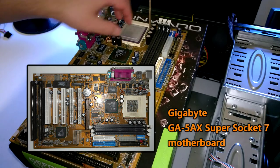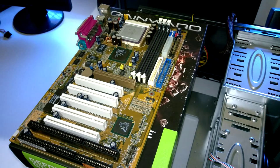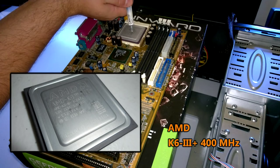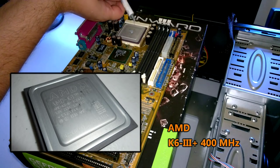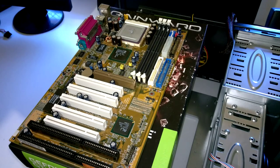I have reviewed a few Super Socket 7 motherboards that are suitable for this project. I will put the reviews in the description. The processor I'm going for is the AMD K6-3 Plus 400 MHz. It is the 1.6 volt version, so it's very power efficient. It has 256 kilobytes of cache, so that helps with some of the later Windows games.